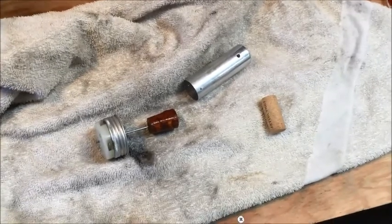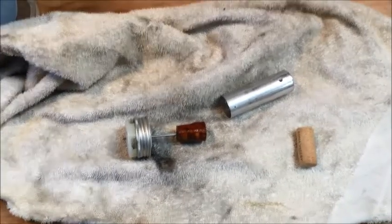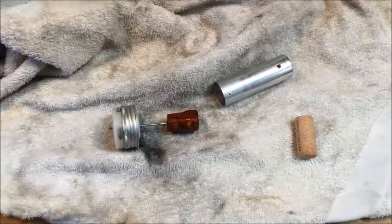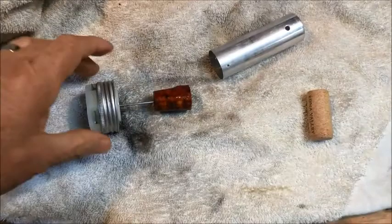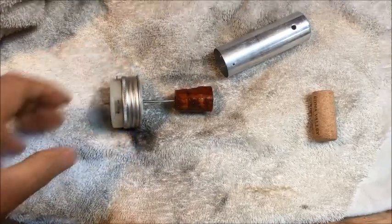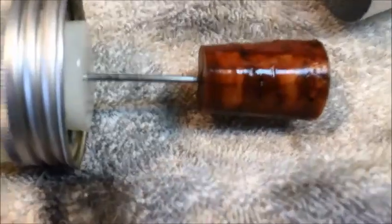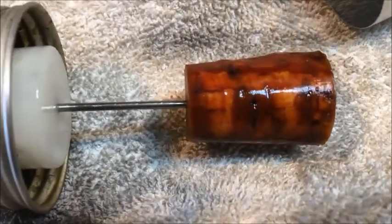Hey guys, John Kerry, 1963 JAG. It's been years, I think, since I put a video up here, but I just wanted to talk a little bit about one of the things that the Jaguar E-Types, and maybe other models of Jaguar, have — these brake fluid reservoir sensors have a habit of getting saturated. This cork has just gone beyond the ability to float.